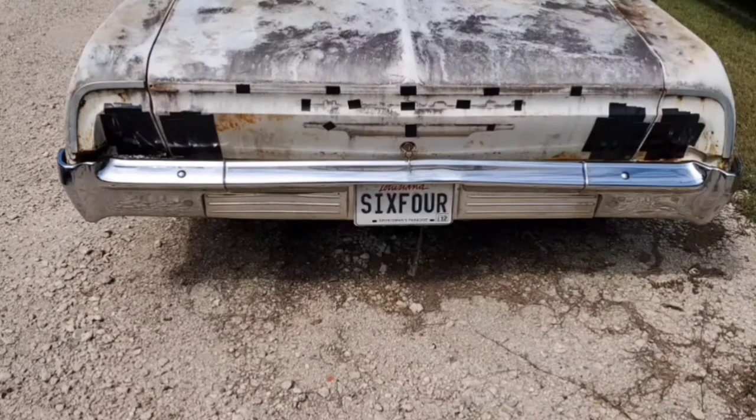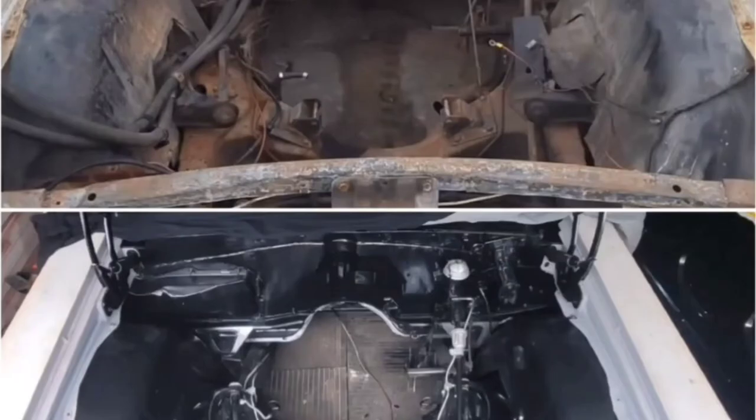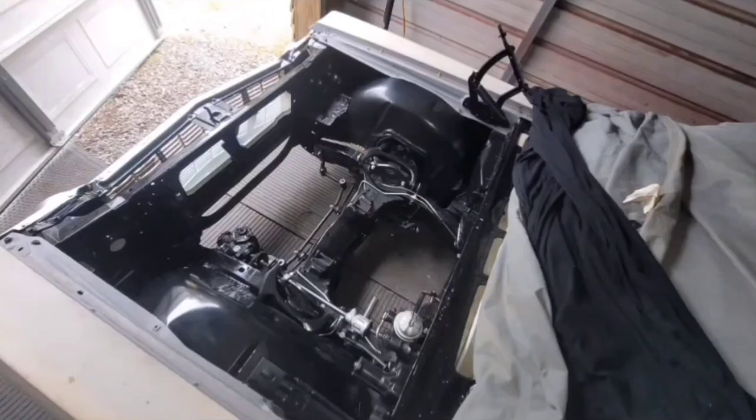This is all the before — how it looked before I started working on it. It does have four taillights in the back; I got an impala trunk. I like six taillights but this is the before. I took this whole car apart — the whole front cap came off, fenders separated, lower control arms, upper control arms, all ball joints changed. I took most small parts to work on afternoons after I got off, sandblasted everything, painted it.